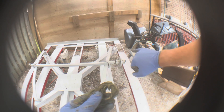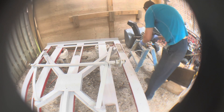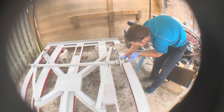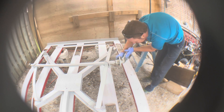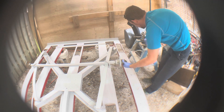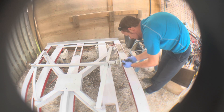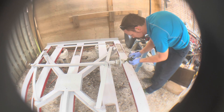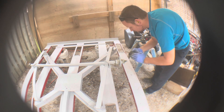Now, the spindle right there — you want to make sure that it's straight, there's no warps or anything. This one's perfectly fine, even though it's ancient. The other thing I'm going to do is add some more grease inside here, just kind of push it all in. I'm going to push the bearing on — in — there we go. That's perfectly fine. We can put a bunch of grease inside the cap.